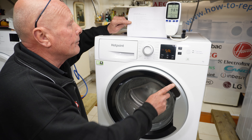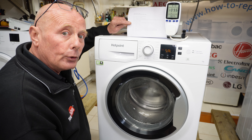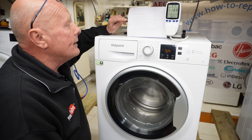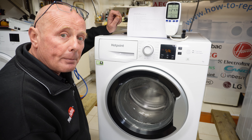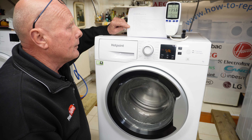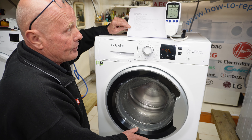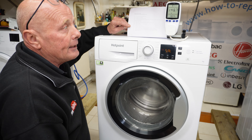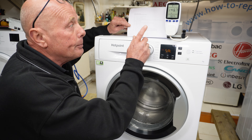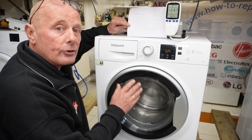F06 is related to the door lock. F07 is an electronic circuit board fault on the heating circuit side — a relay may have become faulty, bad wiring, or the circuit board is faulty. F08 is a heater fault. F09 is a software fault. F12 is an electronic control fault — these last two are related to the circuit board. The pump has kicked in and the motor is building up — we're pulling roughly 146 watts of power under no load. With clothing in the machine it would pull more power, but the test cycle must always be run with no clothing.